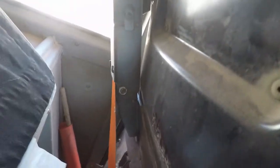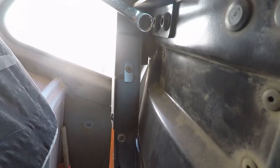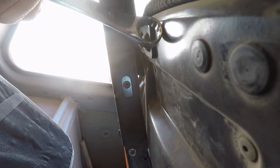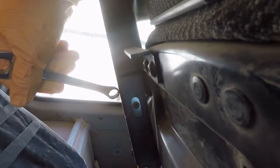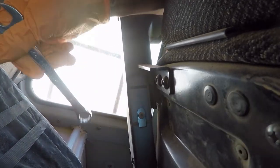We've got this shoulder belt here, but it goes right through the back of the seat, and I'm not sure why. These are Torx bits right here — it's a T50. The nuts on the inside of this are not captive nuts at all. I don't know how we can put a man on the moon, but if you change a seat belt on a Caterpillar, you have to tear the cushion part of the seat off to grab the nuts that are gonna fall off of every single one of those.